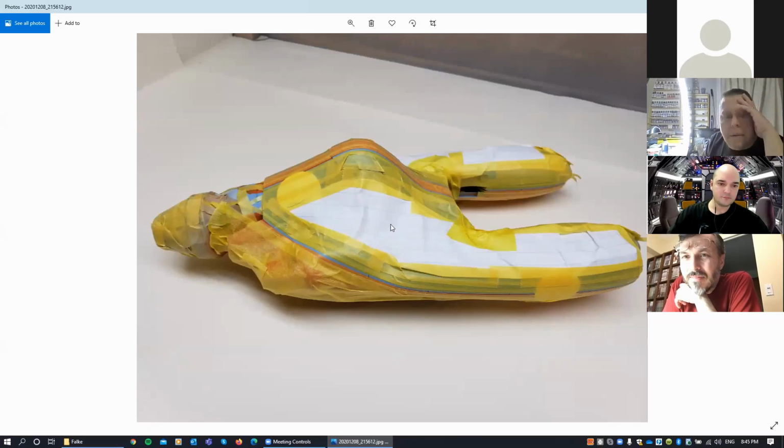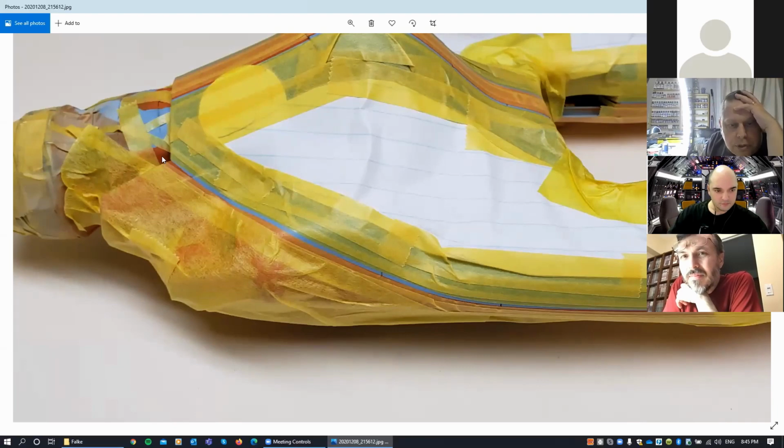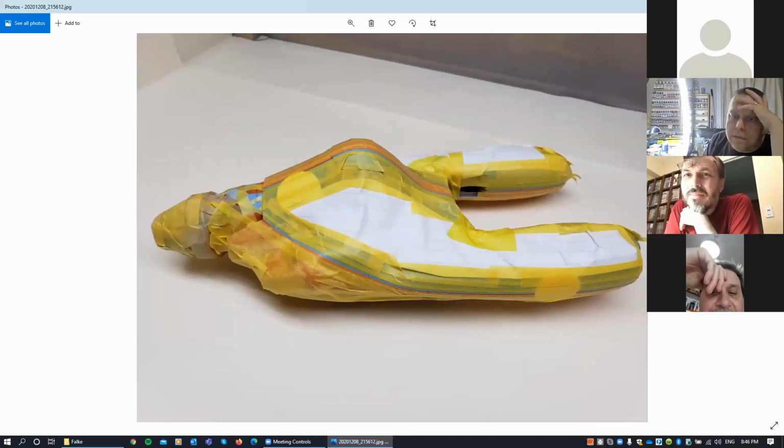And then what I did was I took pinstripe tape, and for the stripe between the orange and the blue Gulf colors, I pinstripe taped the whole thing, and then I masked all around the pinstriping, and then I peeled the pinstriping off. So it left just the black pinstripes exposed, right? So this is like hours of masking, of course, because that's what we do.